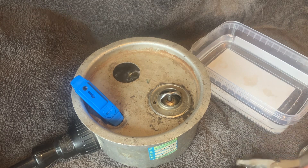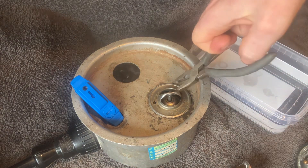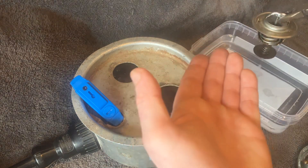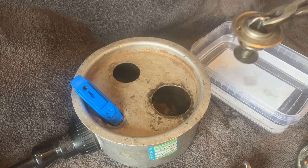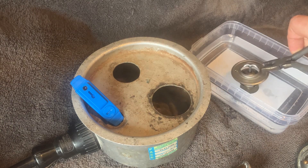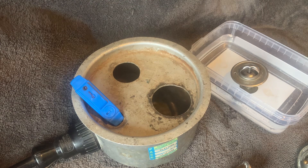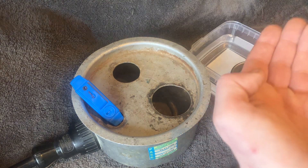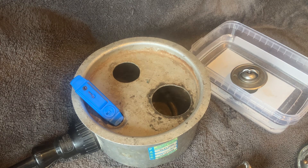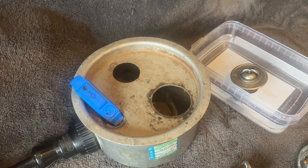There's quite a big gap on this particular one. Because it's extremely hot, I'm going to take it out and place it into this cold water so hopefully you can see that middle section rise back up and close off. That's how to test the thermostat. It's well worth doing — it could save you thousands in repairs if your head gasket goes because your thermostat is seized.